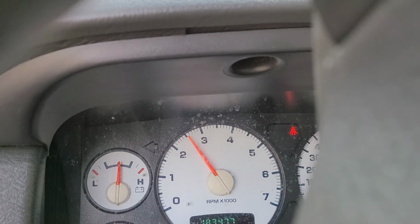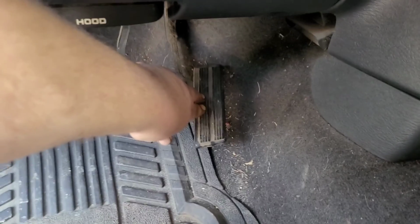I'm gonna hold it up right about there. Let's do that for a minute, and then let's check the hose to see if there's any pressure in it. A lot of times, I don't know if I mentioned this with the Ford Fusion video, I'll start a car up cold and blast it down the street. Full throttle, down the street, like an eighth of a mile, turn around, eighth of a mile back, full throttle. If all of a sudden the cooling system is under pressure, you got a problem. It shouldn't do that on its own.